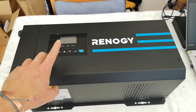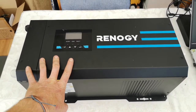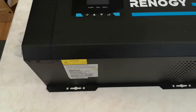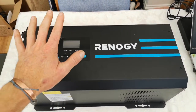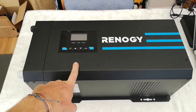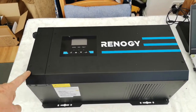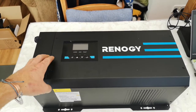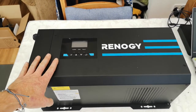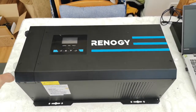We could have bought the Renogy 2000 watt inverter separately and gone for maybe a Victron charger, but this unit has a charger output of 65 amps which is a lot, so it's going to charge our batteries much quicker. It does clever stuff to keep your batteries healthy while charging — we've got lithium ion batteries. It's also got an auto changeover, so we don't need any changeover switches. When we plug into mains shore power, it automatically sends that shore power straight to our 230 volt supply. This does everything.